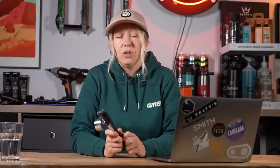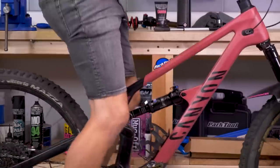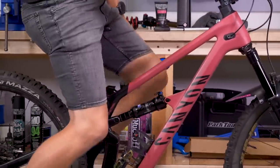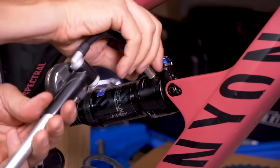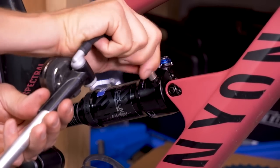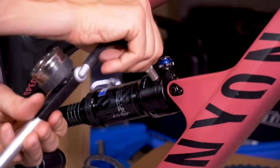This is a little bit of a trick — you're not actually losing air. Assuming your pump is not damaged or dirty, or there's any opportunity for seals to leak air when it's in use, you won't actually be losing any air when you disconnect your pump. Say you're pumping up to 320 psi — when you disconnect you will often hear some air come out, and that might trick you into thinking it's coming out of the fork, but generally it's just air that's stored in this hose here.